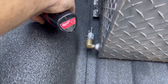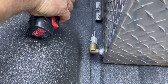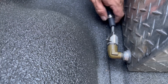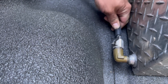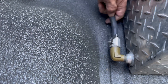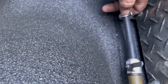Next we're going to put the hose connections on the fuel tank, run it down, and cut the excess off after we get it measured. This barbed fitting can be kind of a pain — it may not be a bad idea to put something on it to make it a little slicker. But most of the time you just push it on. There it is. If you ever want to take that off, you're probably going to have to cut it off. Now I'm going to put the clamp right about there.